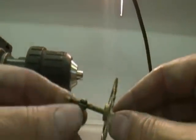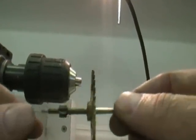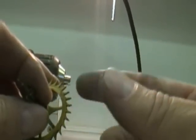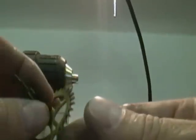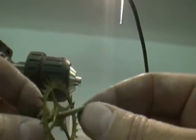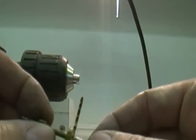Next we're going to do the escape wheel. You can see it a little bit better now — it's really dirty. Stay clear of these little shark's teeth here, especially with the abrasive pad. It'll grab it out of your fingers very quickly, so make sure your fingers are not tied up inside of it.